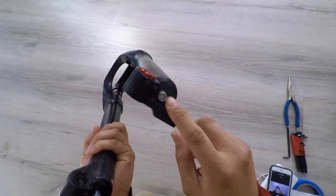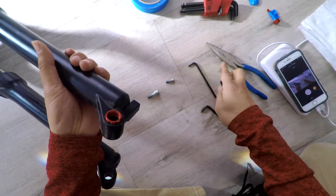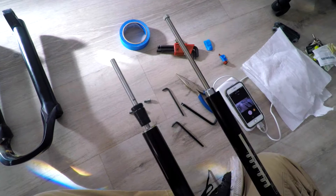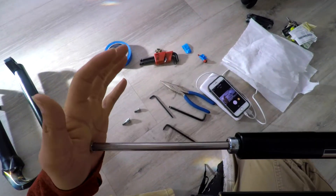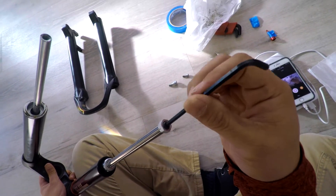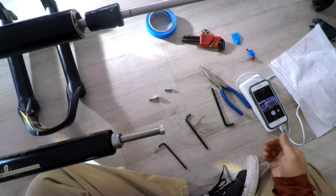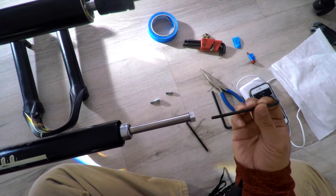Moving to the air spring side, you'll need a 6mm hex wrench — just loosen and remove the screw on the bottom and once you do that you can remove the fork lower. On the air spring side there's a rubber stopper for when you bottom out, and on the opposite side they're using a cartridge damper. There's a set screw inside the cartridge damper — moving it outward gives you a faster rebound and moving it inward slows down your rebound.